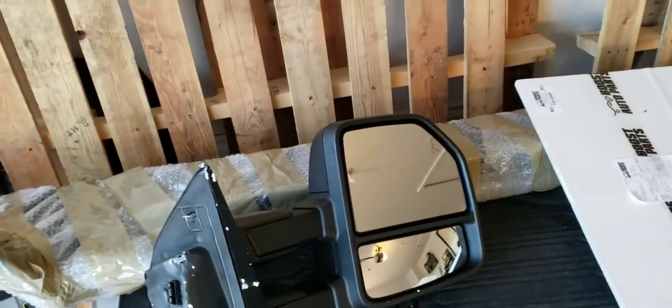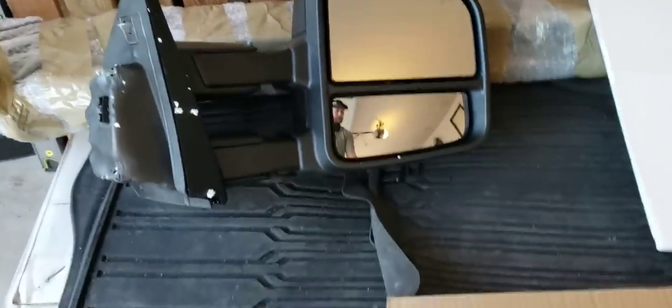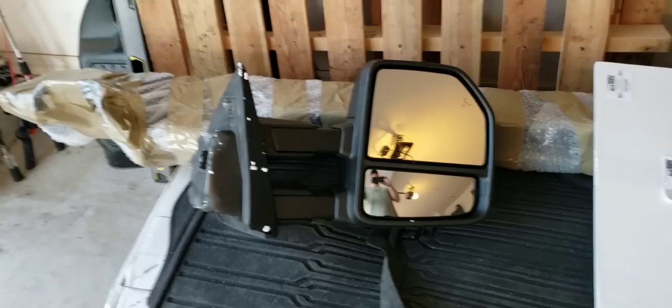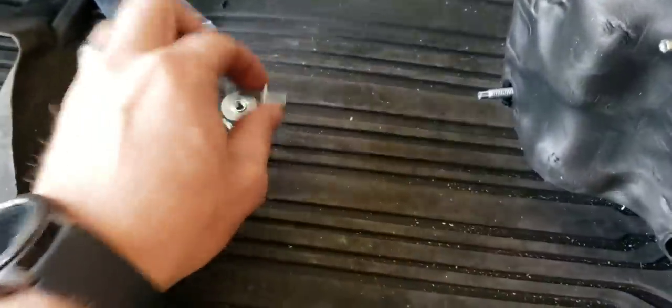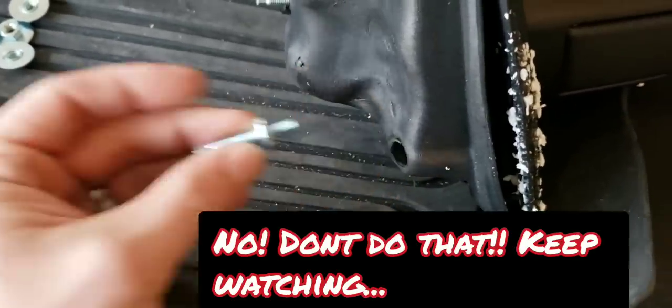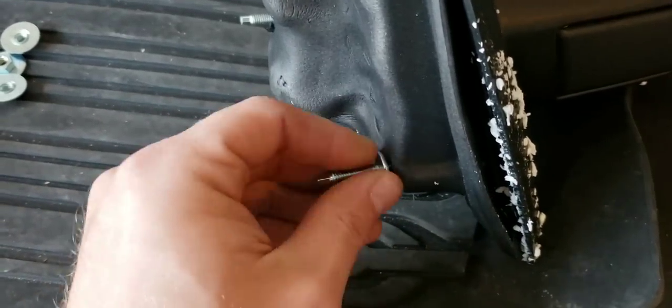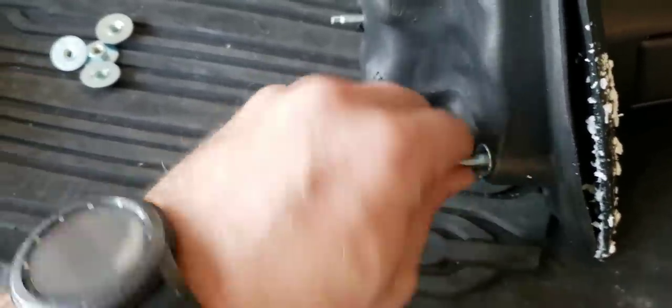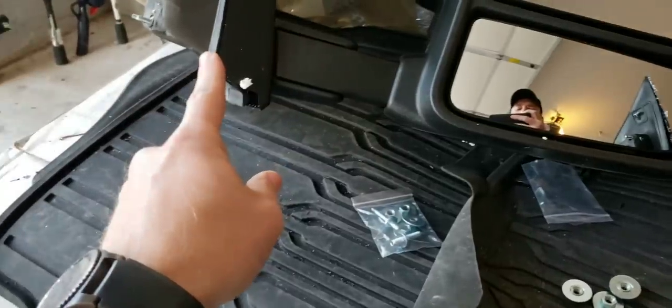Let's go ahead and get these installed — it should be super simple, just unbolt. There are two nuts and these two bolts here. Because I have 22-pin mirrors, I don't have to plug in an extra harness. If you have 8-pin, then you will have a harness that of course will come with your mirrors. For the studs you get, those go into the set of holes in your door — take them and just screw them in, just that simple.